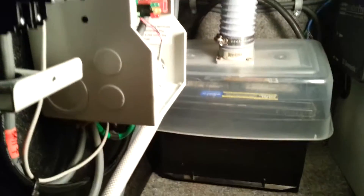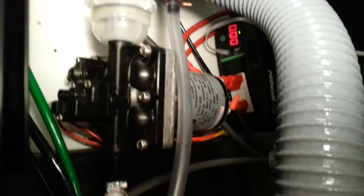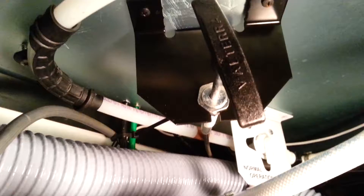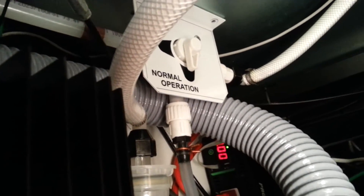Alright, it's night time now. I just wanted to show a little bit before I put my covers on everything and wrap this compartment up of what I did to get it in here. This being on my Winnebago 38J - this was my little water compartment and I had to do a lot of changing to get it to work. The water pump wasn't on the floor, so I moved the water pump up here on the backside. My lever for the dump valve for the fresh water tank was on the sides - I removed it from the side panel and moved it to the ceiling. Same with my little bracket for the normal operation divert - I had to move it to a different position to make enough space.